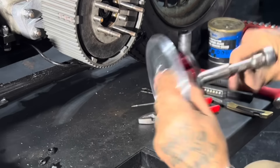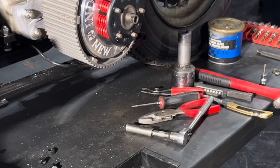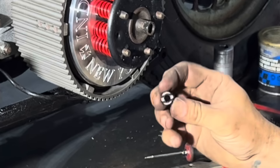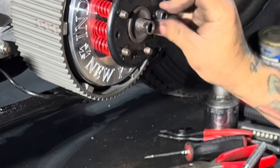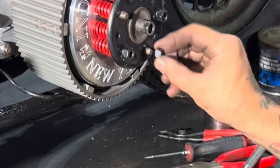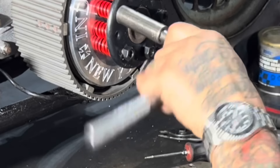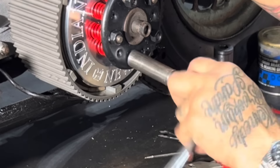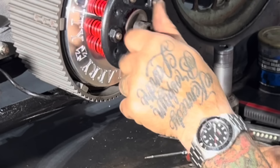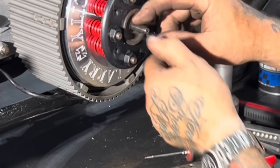I'm going to compress it down a little bit. There you go. Then you put your clutch hub nuts on - there are five of them. They have a little groove cut in them that locks them in place so they can't spin off. You have to put the little groove facing in. This may, in fact, be the one millionth time I've done this. You can hear those nubs clicking in those grooves as I tighten these down - that's what keeps the nubs from being able to spin off. That's the trick. That little washer right there - everything else belongs on the bike; the washer doesn't.